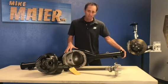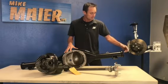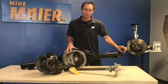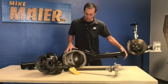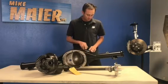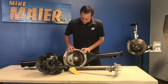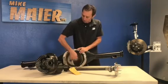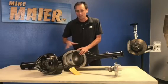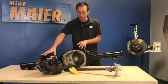They come with billet hub ends, which are beautiful and accept bearings and seals nicely. No longer do you use the T-bolts on the hubs, so it makes for a really clean, easy application of your hub ends. The breathers are baffled. The housings come with the option of being plumbed for you. The inside of these axle housings are baffled, so it makes it much harder for oil to splash out of the hub ends, which would potentially starve your gear set of oil.